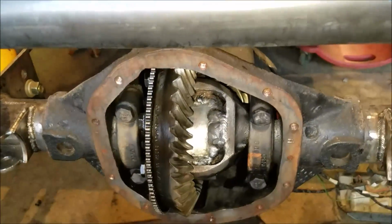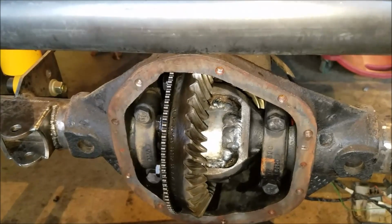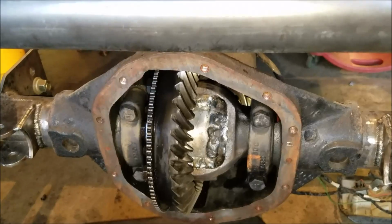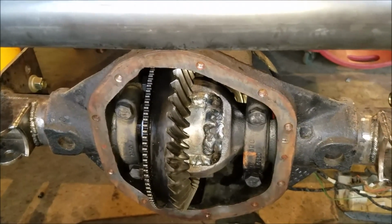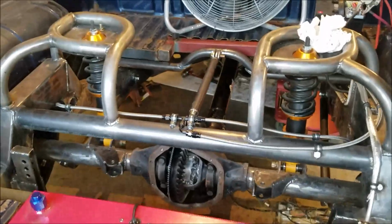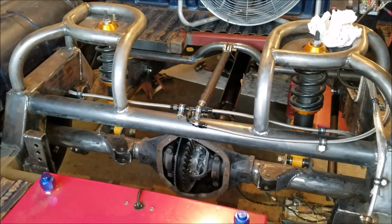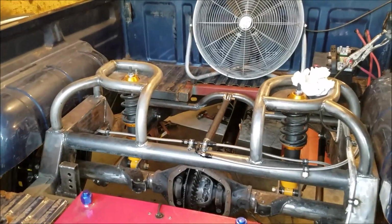Welded gears to themselves, gears to the case, and gears to themselves with a plate in the middle. Yeah, that's how it's supposed to be done. On both sides. Yeah, that's not coming loose whatsoever. Looks like you got good deep welds. Oh yeah. So I mean, the gears are hardened, so when you weld on them, they get hot, and they're not so much hardened anymore, and that's why you had so many issues. But when you got it packed in like that, it's not going anywhere. It's going to stay. As long as, you know, hopefully you don't shear an axle, but we'll find out tonight probably.